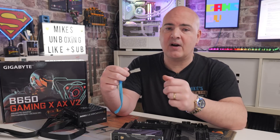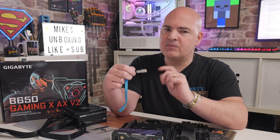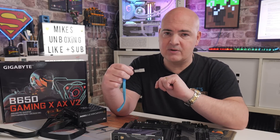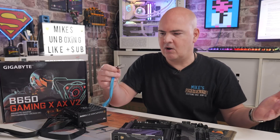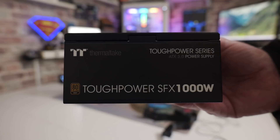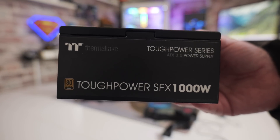If you have a drive larger than 32 gigabytes, you can create a smaller FAT32 partition on the drive, but it just means it's another step. So if you've got a smaller drive, use that. If you've only got access to a larger drive and want to create a smaller FAT32 partition, there will be a video link in the description showing how that is done. Also, you need a power supply to power the board itself.